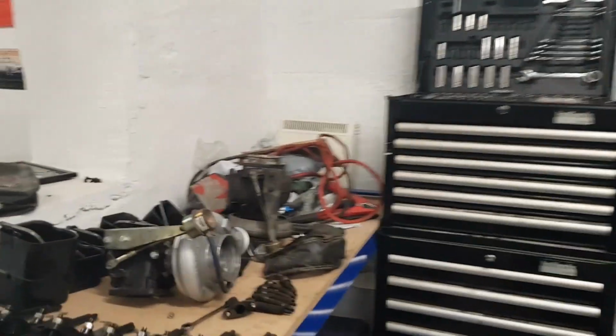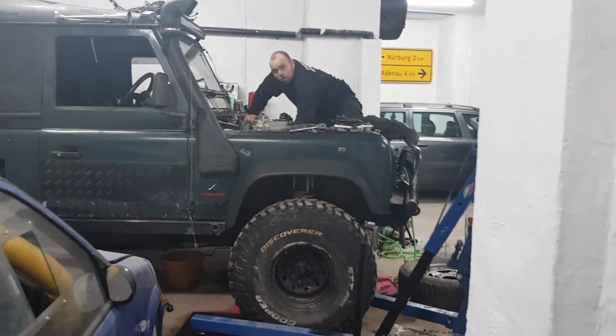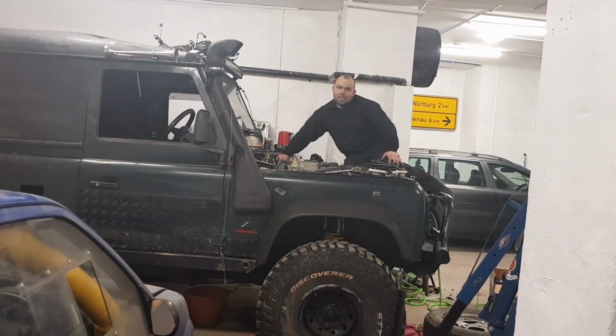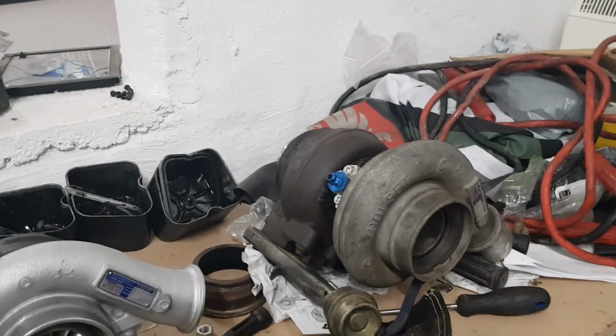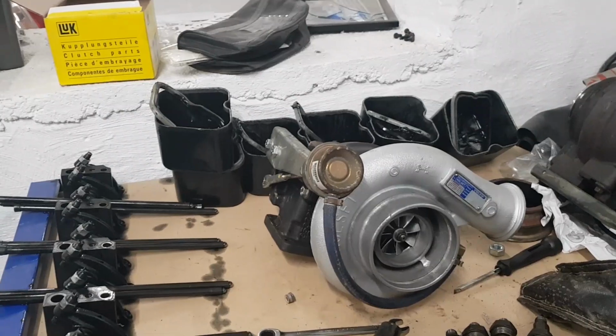If anybody actually views this, and we do get any viewers, that HX40 there will be for sale, won't it, Josh? Unless Mikey's going to make a hybrid of his own. He's got the genuine HX35 Holset turbo on his truck now, so he's already got the correct exhaust housing. He'll hopefully be able to use the hot side from his turbo with the cold side from this turbo to make that turbo.